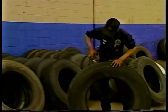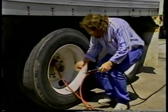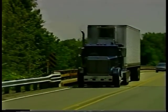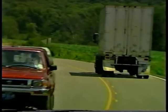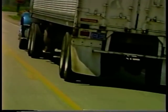While road hazards contribute to a large number of en route tire failures, properly aired, matched, and well maintained tires experience a much lower rate of road failures. Tires which are overloaded, under-inflated, or carry a heavier load due to being mismatched generate substantially more heat than properly inflated tires, and heat is a tire's worst enemy.